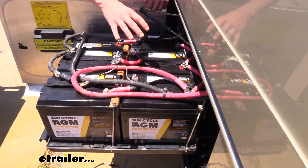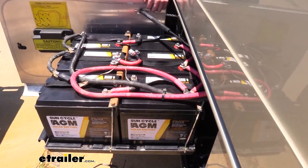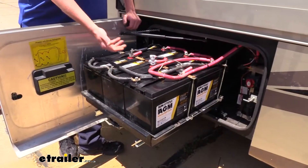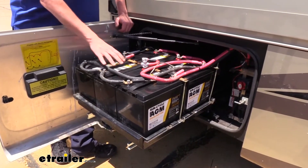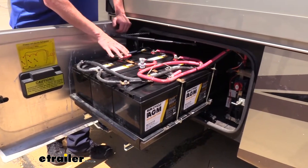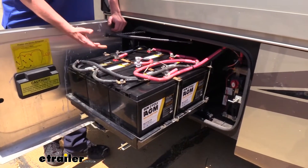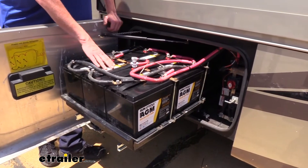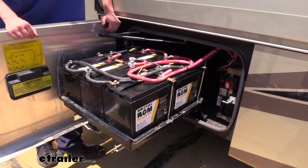That can also decrease the life of our newer batteries because of the charge strategy being used. Unlike our original batteries, which were a flooded battery that have caps on top so you can add fluid, these are completely sealed AGM batteries. What's nice about them being completely sealed, especially if you're ordering them at home, is it does exempt them from being a hazardous material, which reduces shipping costs getting these to your house.